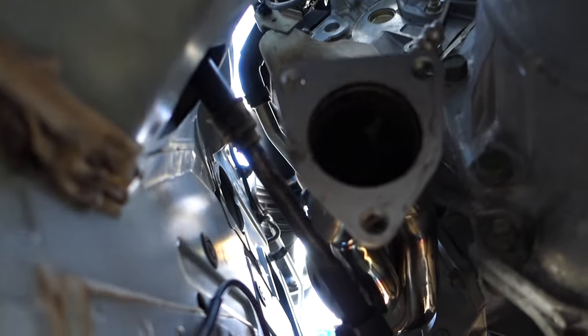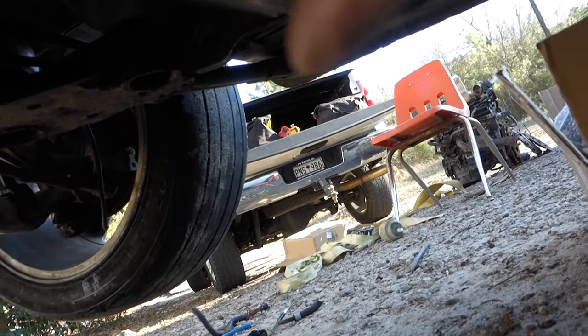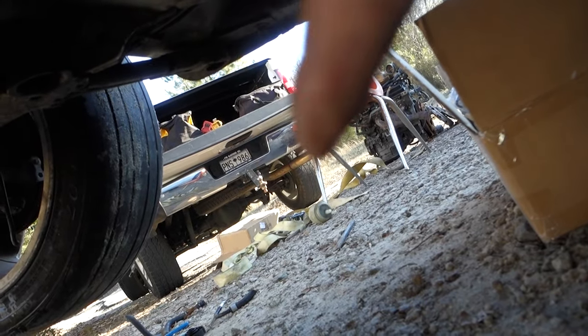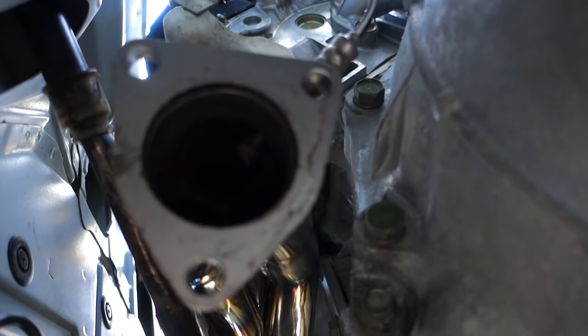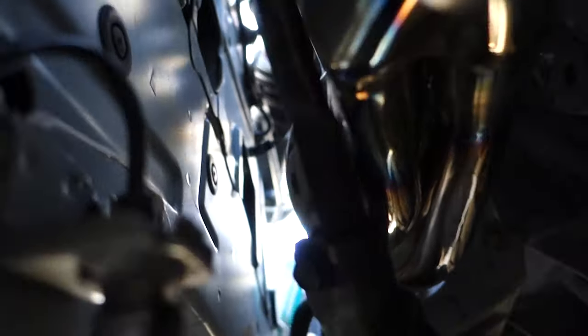And I actually put the old test pipes I had, bolted them to the flange, put the pry bar in it, and then hooked it to my truck right over there with a big strap, which you can kind of see laying on the ground, and heated it and ratcheted the header over to the motor. So there's no way this thing would have gone without serious modification.